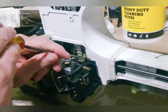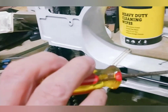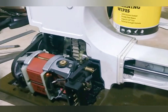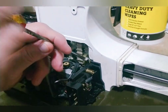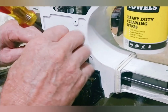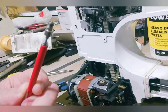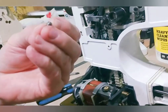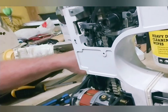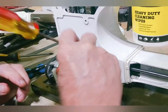Now we're going to snug this one just a little bit so it holds everything like we want it. Now we're going to pull the silver screw out. See the needle plunge — the needle's at its lowest position and starts back up. And this silver screw is what's exposed. This is the one we need to be able to loosen in order to adjust the bar. This tip bites the rod. So every time this screw goes in, it wants to go back into the position it was in last time, so that tip goes into the hole it made. So if we put a black screw in there — that's why they tell you to switch — so it won't slide back into its old evil ways and assume the position it was in.